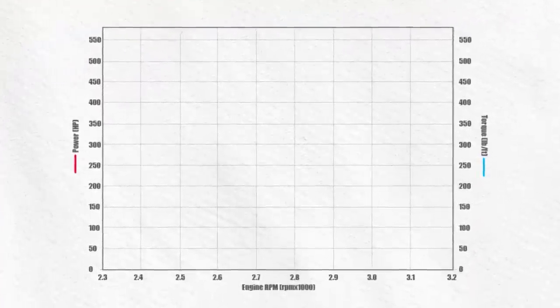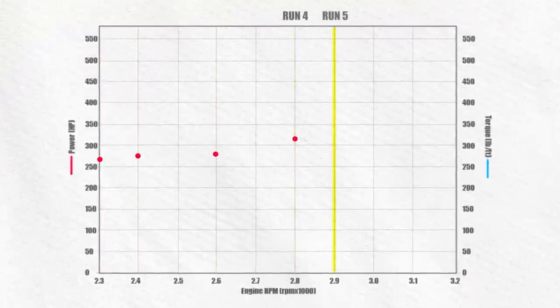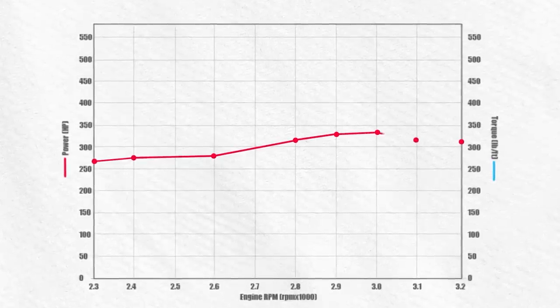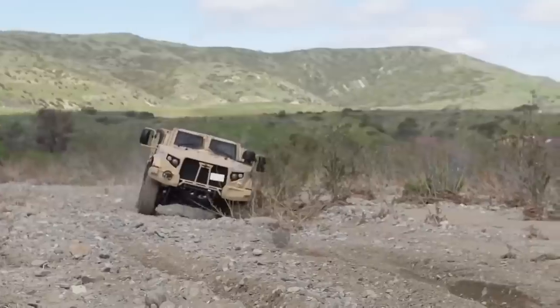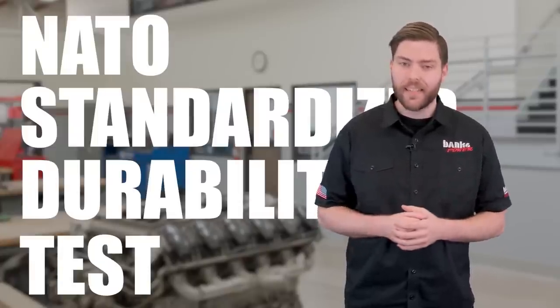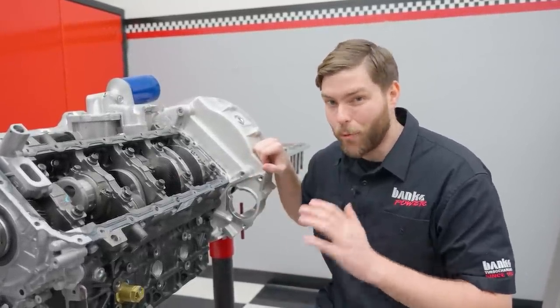If you run enough steady-state tests over a set of RPM increments, you end up with a horsepower curve that resembles a sweep. Since the dyno sheet does not include the amount of time taken, we can set an RPM, wait for all the temps to stabilize, take a reading, and then move on to the next RPM increment. This is the kind of testing that engines undergo when they're in development. While we were developing the power plant for the Army's Joint Light Tactical Vehicle (JLTV), the Banks D866T engines were subjected to a NATO standardized durability test — a 400-hour test — to eliminate the variables and build an engine that can stand up to real abuse.